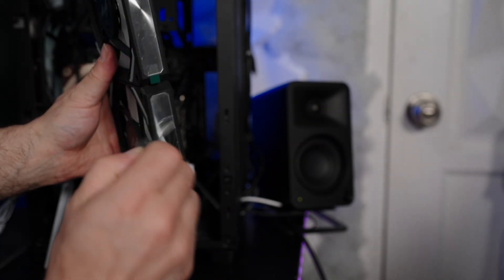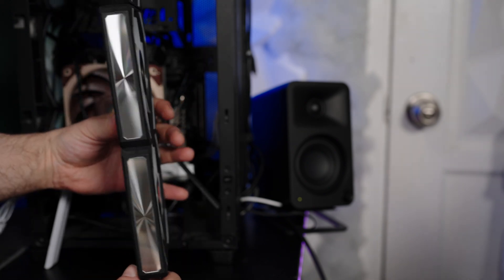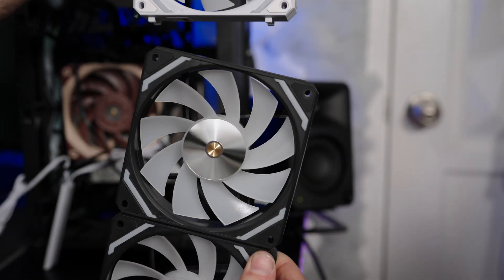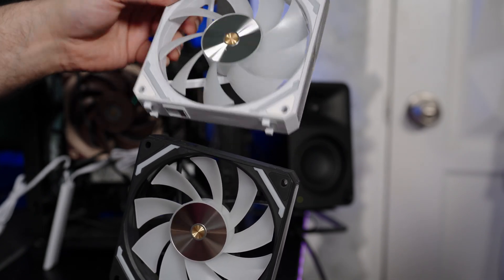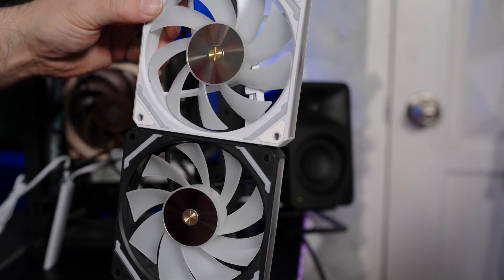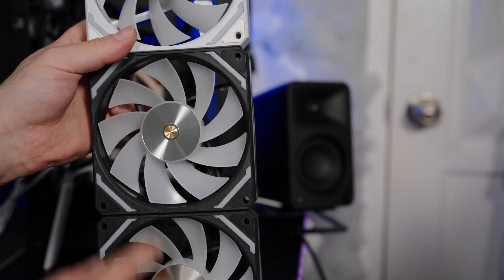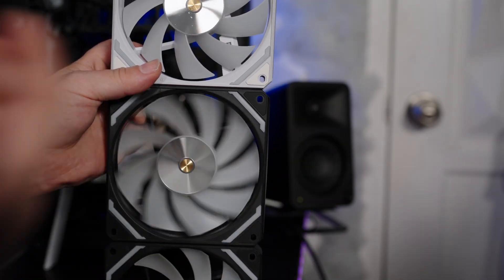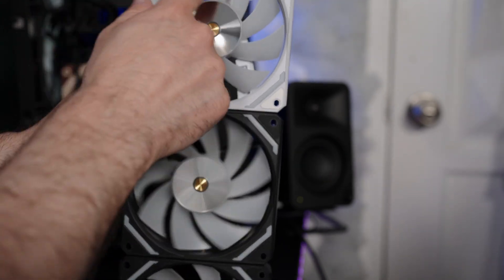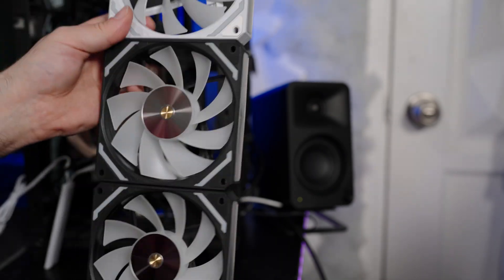Slide it over — might need both hands — there it's in, and we still have another groove so let's connect that one too. Let's take that little packing tape off. Whether you have the reverse flow or the forward flow fan, white or black, the circuit boards are shiny — shiny side to shiny side is the way to do it. We can see the fan hub: this one is facing this way, which is reverse flow, blowing inside the case. That's how we tell the difference.